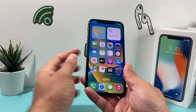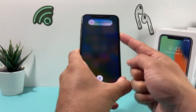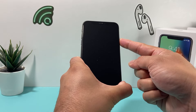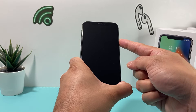I'm going to do it in real time — I press volume up, then volume down, and then I hold the side button just like that. When you hold the side button, you do not slide to power off because that will be a normal shutdown. You just keep holding the button, which is forcing the phone to shut down completely, and then once I see the Apple logo, I will let go of the button.